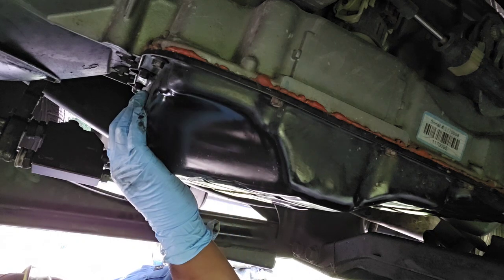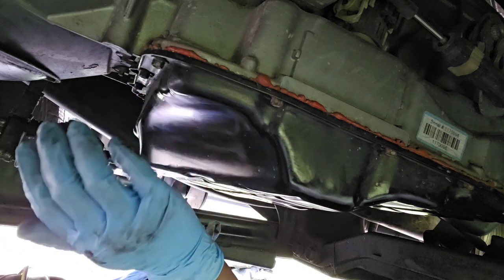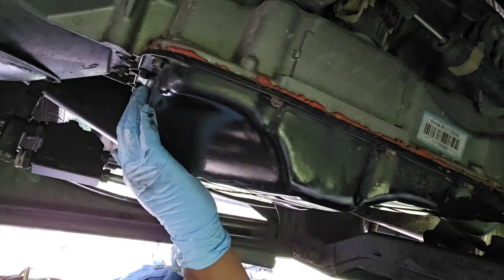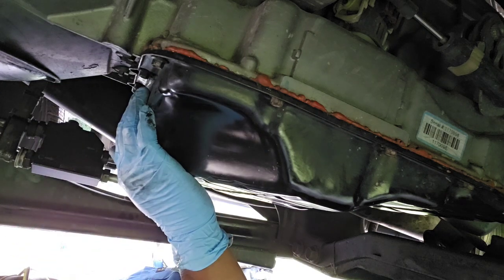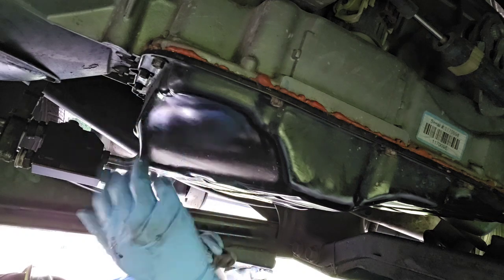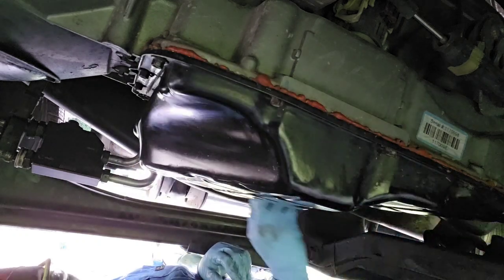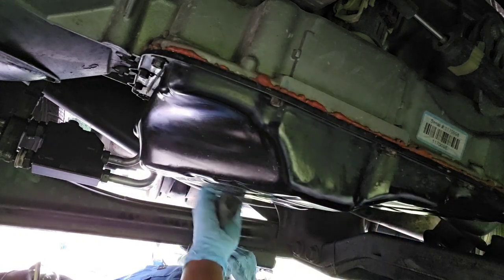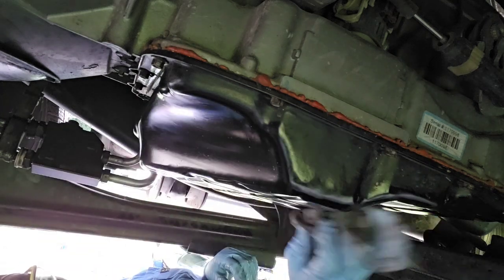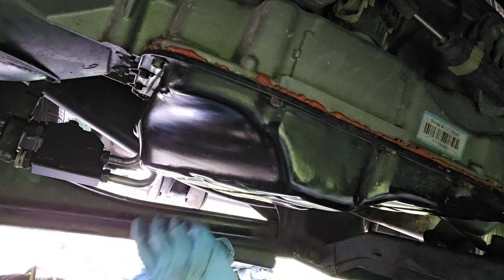I think I serviced it the first time after 60,000, and the second time after like 150,000 or so, and now it has 222,000 miles. So I'm about 12,000 miles overdue, but better late than never. The hard downshifting, sometimes when it shifts hard, is an indicator that the filters are clogged, so I am going to replace the filters on here.